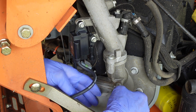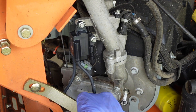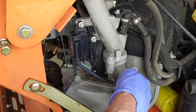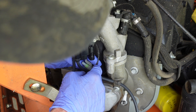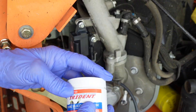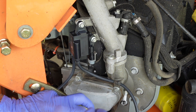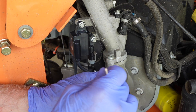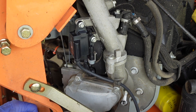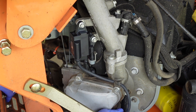My bad on that one — I did not have to remove that. It should be straight up. Be very careful with these; you can see how small these wires are. I'm going to use a little silicone grease in the spark plug boots. You can feel it. I did think that one was going to go. I'm looking at the other side, just making sure my orientation is kind of identical. I felt that one snap on.